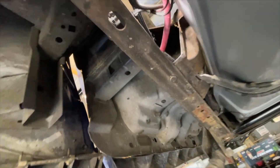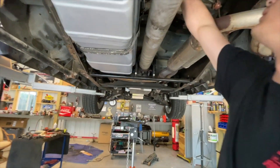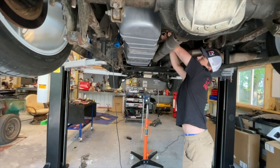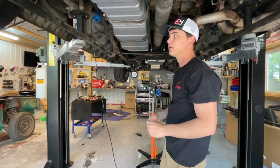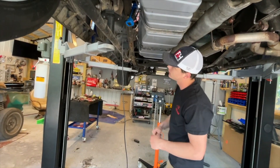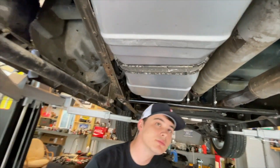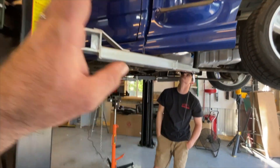It was just a bad day yesterday. Andrew put his new gas tank in, and as you can see right through there, that bolt was actually pretty loose. Andrew's coming in right now checking everything — the truck stalled out on him a couple of times. It stalled out on me at the gas station and didn't want to crank back up. I popped the hood, checked the fuel pressure, and figured I'd left something loose — either the ground or the power wire going to both pumps. Luckily it was that bolt right there, a little loose. We think that's the problem; if not, it'll be a connection inside the tank.